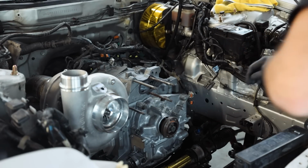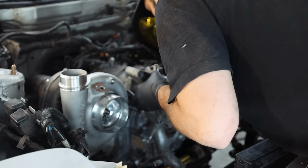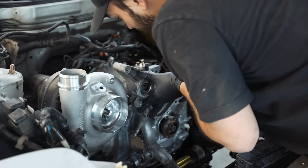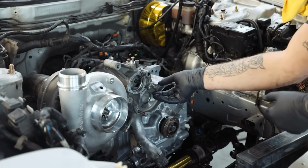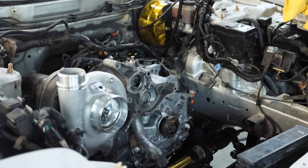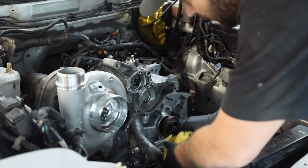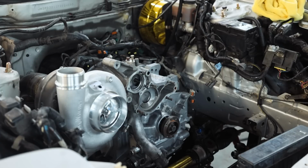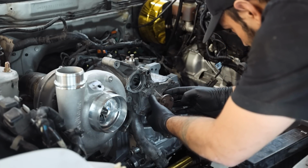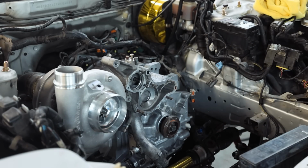Alright, cool. Water pump housing gasket. Go on somewhat like this. Just like that. And then our water pump will sit right on top of that. That turbo sits so close to that water pump housing. Holy shit. So lower radiator hose, well, it seems like will go right there. So I did find the old one, but yeah, it does use all the holes. So let's let it chill right there for now until our new water pump comes in.